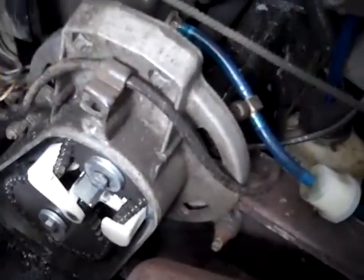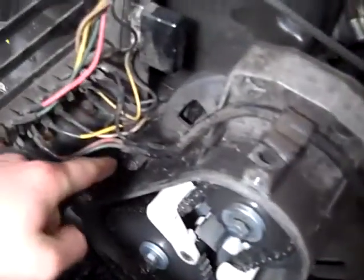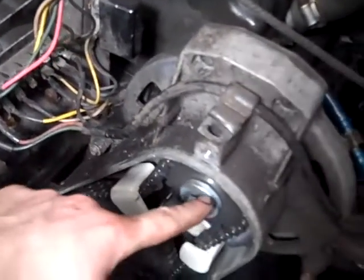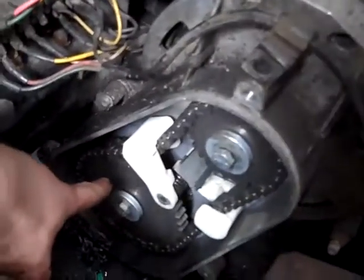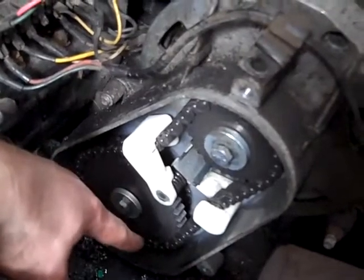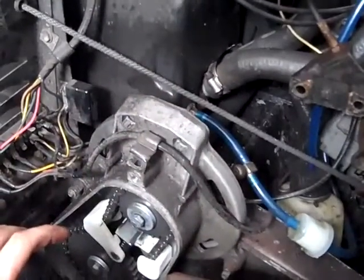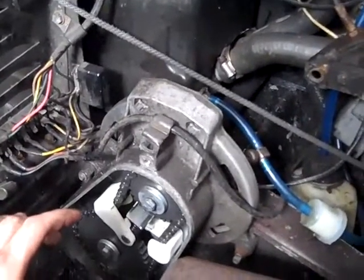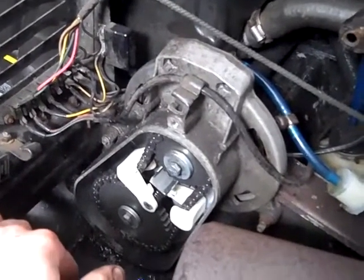In order to get to the inside brake pad, you have to take this bolt off, this bolt, and these two bolts here that hold on these gears. Then down here there's three bolts that hold in the bearing — you have to take those out. Then once we get everything loose, you can pry the chain case to the side so you can just get to that one little pad. It's a lot of work, but it sure is worth it when you have good brakes.